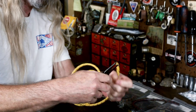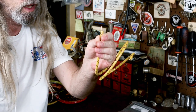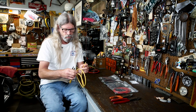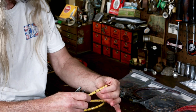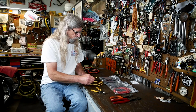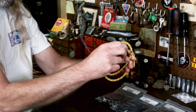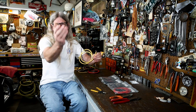So this is just a common everyday wire stripper and I'm basically using the largest portion. When I'm cutting into this wire I'm just being careful not to cut through the center part. When you're working with the stranded copper, if you cut into it you can tell because there'll only be a couple strands left. It's always a good idea to put the spark plug end on first with the 90s, because if you screw up you can cut it shorter and then go to the coil — those ends are much easier to put together than the 90s. Here is the difference: look at that stranded copper versus suppressor, which is just a piece of carbon that conducts the electricity.